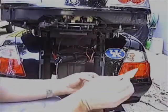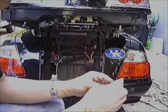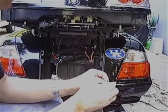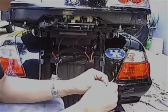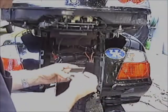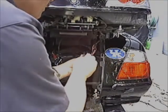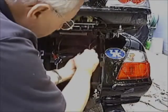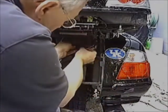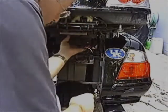Here's a little hint for the double-sided foam tape for mounting the unit. It would be natural to peel the white protective coating first and stick it on the unit, but then it's a real hassle to peel the red coating off. If you peel the red protective coating off and put that side on the unit first, then it pops right off and you can slide it in and press it up — and it's mounted.